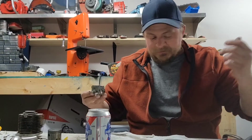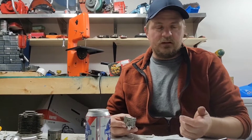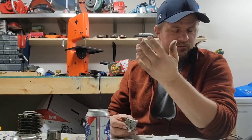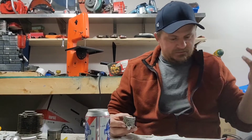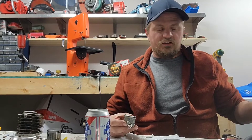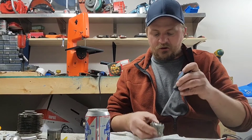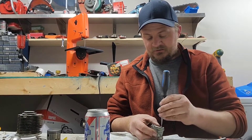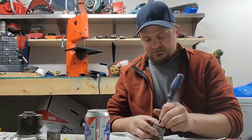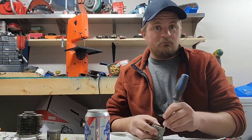So with this carb: the check valve is okay, passages are clear, diaphragms are good. I pulled up the metering lever a little bit. Maybe it's been rebuilt — someone's put some stuff in the carb and I imagine it's been rebuilt in the not too distant past. I really don't know. We'll see. I'm going to check the fuel filter after I get this back together.